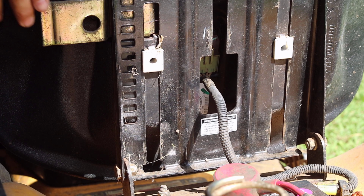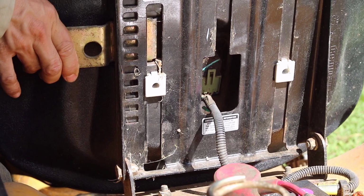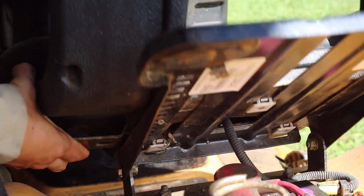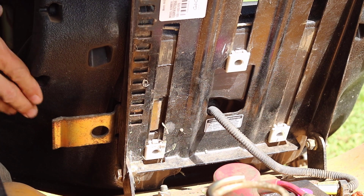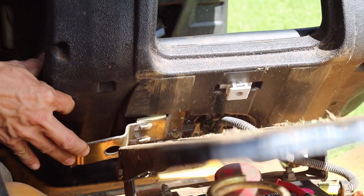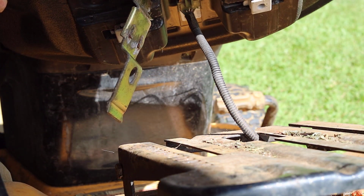The seat lever was again used to unlock the seat from the seat mounting bracket. With the seat unlocked, it was able to slide down the track. At this point, the seat can be removed in the down position by pulling it forward. I chose to lift the seat up again to give you a better view of how the seat slides off